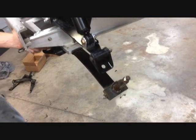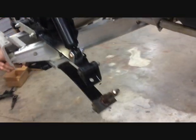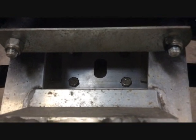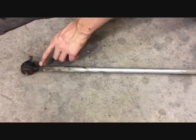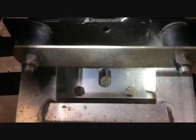Reinstall your spindles, your tie rod ends, and your stock tie rod. You can adjust your toe by lengthening or shortening the tie rod. You can also adjust the camber a little bit with the centering pin — loosen that. Your tie rod has threaded rods on it; if you loosen the jam nuts on both driver and passenger side, you can thread this and it'll toe the car in or toe the car out. We recommend one-eighth to one-quarter inch toed in. Double check to make sure you've got all your cotter pins in and everything is securely tightened, and you're done with this install.